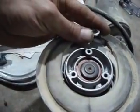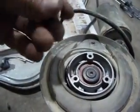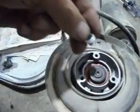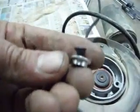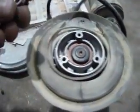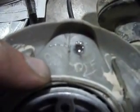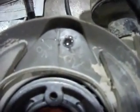Now this little piece here, the belt runs around there, and it just adds a bit of friction so that the pad doesn't turn too fast. Well, this thing was frozen up solid, just like about everything else with it, even though it wasn't rusted. Now the trick to this son of a gun, which I just learned, is that it has reverse threads. So I wrote on the thing, on is counterclockwise and off is clockwise.